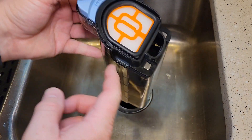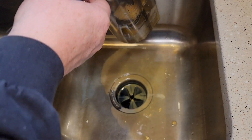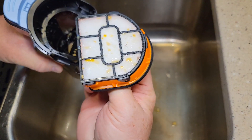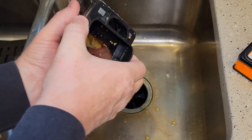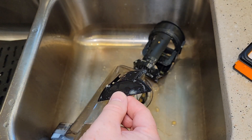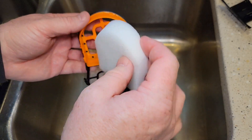Here's the dirty water tank — it comes off really easy, it's got a nice handle. You can pour the contents out, run some water in there, slosh it around, but you're probably going to have to clean this each time. Lift the filter up — there's the filter. You can see there's quite a bit of stuff in there. Lift this out — looks like there is a piece that comes out also. This filter has like a cover — take the cover off, take this out and give it a good cleaning. They do want this really dry — you're supposed to let this dry for 24 hours before you use it again.